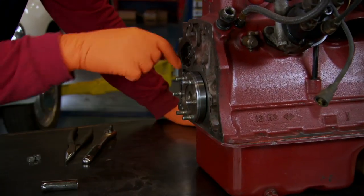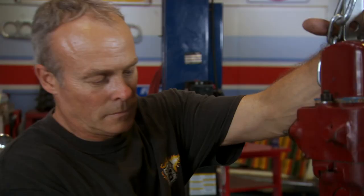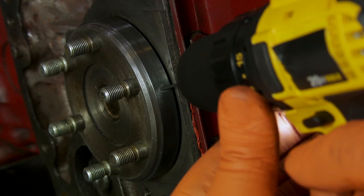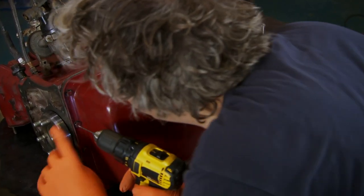Flywheel off — that's fantastic, and that's actually looking pretty good. I now need to secure that to be absolutely sure it's going to stay put, and for that I'll need some assistance. So, Paul, give us a hand. Paul helps me turn the engine over and brace it. I drill an exacting four millimetre hole to secure the slip ring and I'm careful to get it dead straight, otherwise it can't do the job.